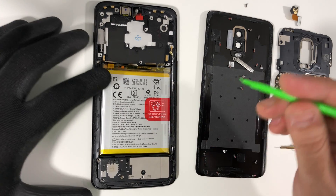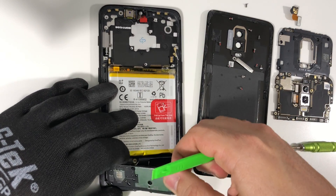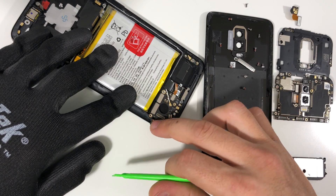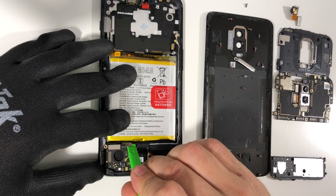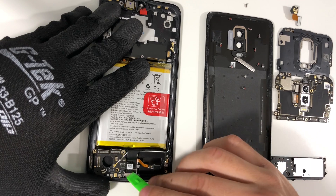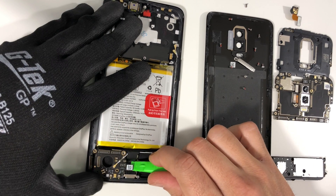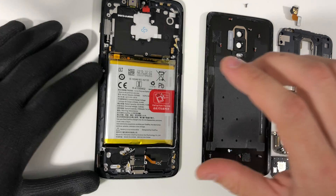With the screws out of the way, use the prying tool to wedge up on the loudspeaker portion to remove it — it is held down with a little bit of adhesive but you can pull it right out. Next, disconnect all the flex cables on the bottom portion motherboard: this cable is for the screen assembly, this one is for the fingerprint scanner, and this one connects to the main motherboard — move them out of the way. Remove the white antenna which connects down here to this portion of the motherboard and pull it out. Then wedge under the motherboard with the prying tool, lift it up gently, and pull it out with your fingers.